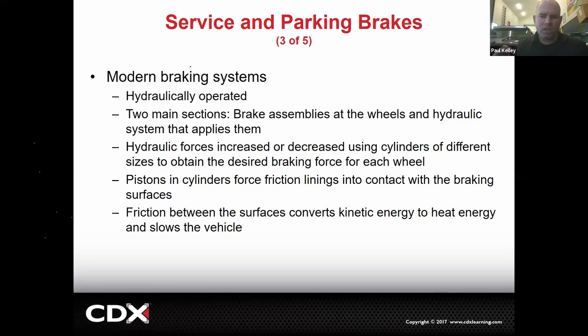Is it a very good build if you tripled the horsepower and gave it the ability to go twice as fast, but you still have the same brakes? Those brakes were more designed for the stock 86. If you make the 86 like a high horsepower beast, you should make the brakes a high horsepower beast, right? Because your brakes are sized to take a certain amount of kinetic energy, and kinetic energy is mass times speed. You didn't make the car heavier. You might have even made it lighter, ideally, but you've increased its ability for speed. So your brakes are now basically not up to the task, right?